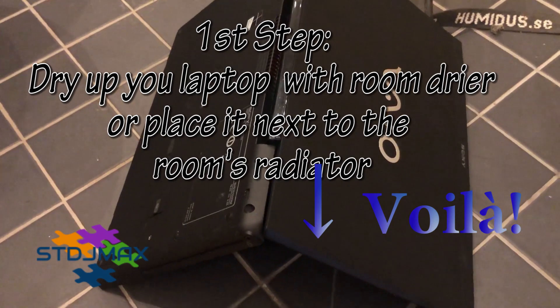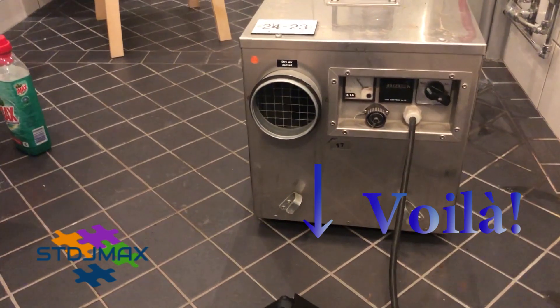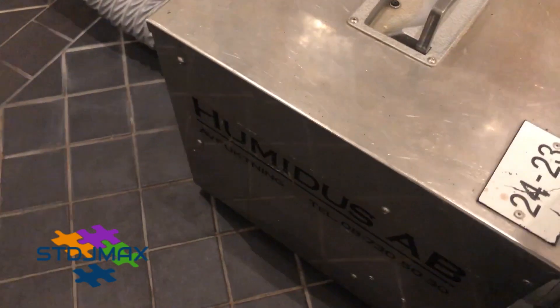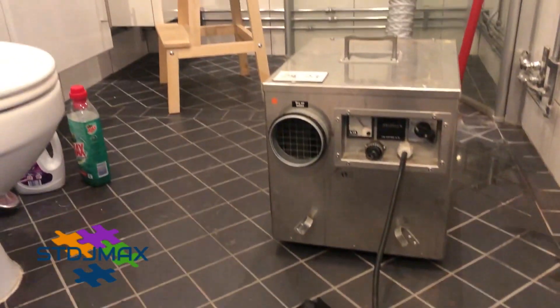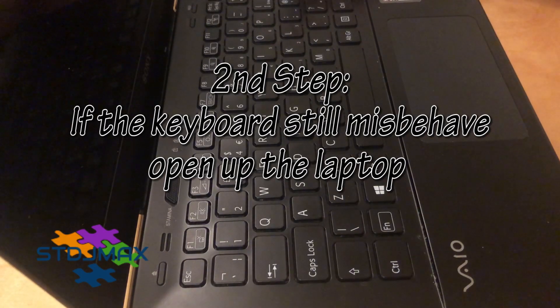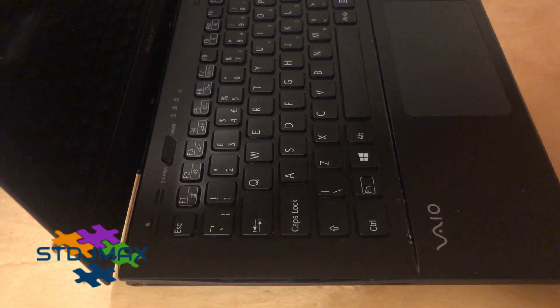Initially, it's a good idea to dry out your laptop before you turn it on after water has been spilled on the keyboard. It's a good idea to leave it for a day or two to make sure the laptop is completely dry. Now, if you have turned on the laptop and the keyboard still does not work, it's probably a good idea to open the laptop.